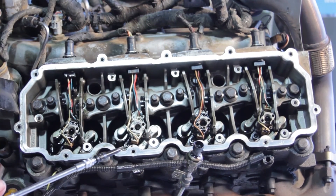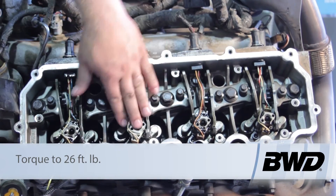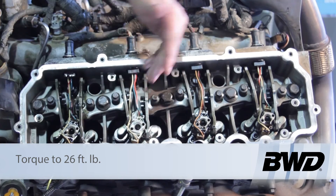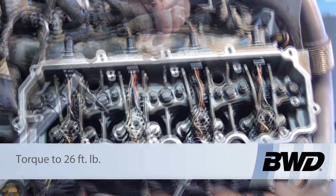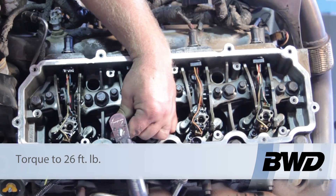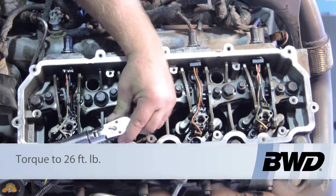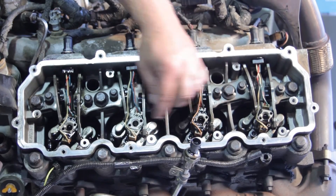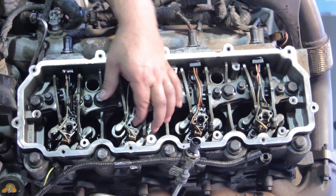Now I'm going to switch out my quarter-inch ratchet for a torque wrench. I need to torque this down to 26 foot-pounds. It's very important we get the proper amount of pressure down, holding that washer down at the bottom to seal it off from compression, as well as making sure that our O-rings land in the proper place. I've traded off my ratchet for a digital torque wrench, set for 26 foot-pounds, and I'm going to go ahead and torque this hold-down bolt. There, we're all set with that. Now I want to take a little bit of oil as well and lubricate the top of this injector here.